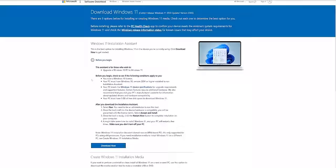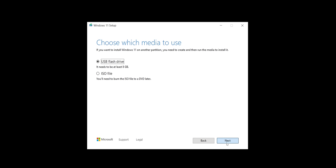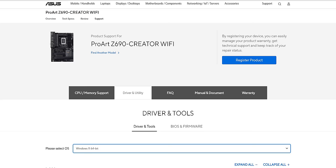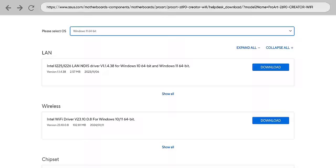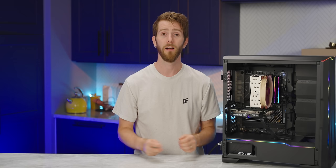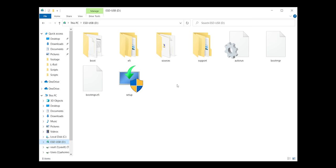Step one is to download your OS — we're going to use Windows 11 as our example, but most of this also applies to Windows 10. Microsoft provides a free tool to download an ISO that can be saved to burn or used to automatically build a USB installer — link down below. Download it, grab your USB flash drive, make sure anything you care about on it is backed up because this is going to wipe it clean, then go through the prompts. The recommended version is almost always what you want — choose USB flash drive, select the drive, and it's off to the races. While you wait, I strongly recommend downloading your hardware drivers from the manufacturer's websites — in particular your network driver, and some systems may also need the storage driver to get through Windows setup.